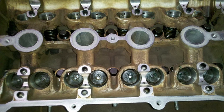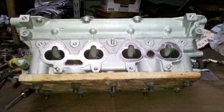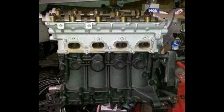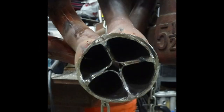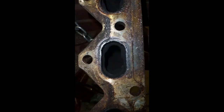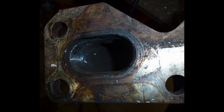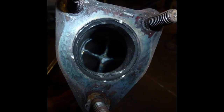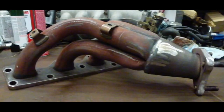Here's the head without the valves in it. I put a board on the bottom because I had to put the valves back in, and I made a press tool that I put in my drill press to pull it down and put the springs on and get the keepers back in. I cleaned out the big welds in the exhaust manifold — had to grind it all out, then weld along each of the four ports. Here I'm looking down into the exhaust manifold; I ground it all out so it was nice and smooth, then welded around the collector.